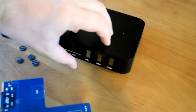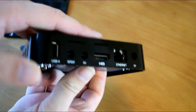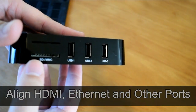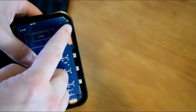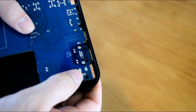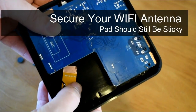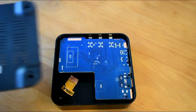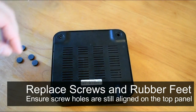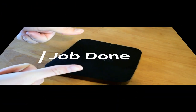Now we can reassemble our board. The reassembly video is taken from an older clip so don't worry that the button isn't visible in it — reassembling is basically the same process. Make sure your cables are all tidy and not sticking out or getting trapped anywhere. The button sits on the front of the MXQ box, directly opposite the power input. If you have a square motherboard it takes up more space, so you might need a smaller switch — check your motherboard before buying. Align it properly so everything goes back together cleanly. That's it — thanks for watching!